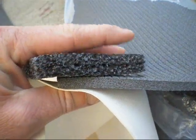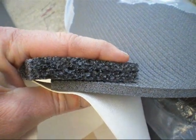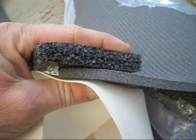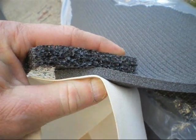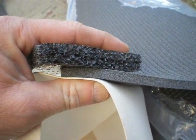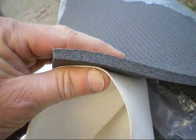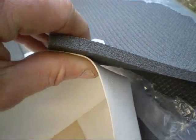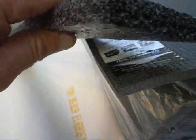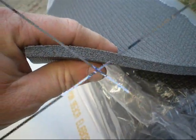Here's what I'm thinking for the big trailer: the interior wall, then the thick half-inch foam, then the 5/16 eco-foam, and then the vinyl. That's going to give me about an inch worth of insulation. This is fine for the bigger trailers but I probably wouldn't recommend it on the smaller ones. For smaller trailers it would be better to go with just the eco-foam and the vinyl. And if this doesn't work out, maybe I'll just go with eco-foam and the marine vinyl.